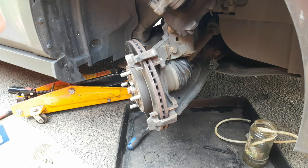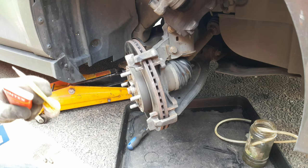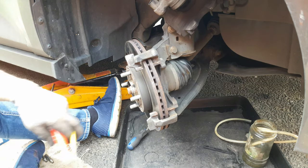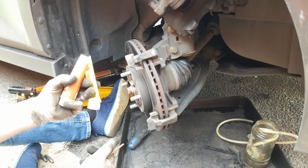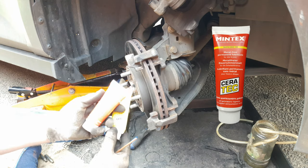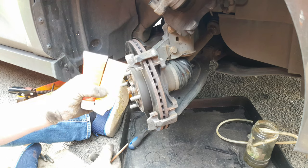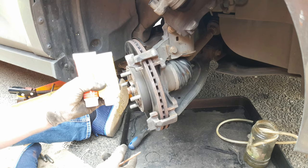Now it's time for a little lube just on the contact points and the slide pins. Do not — I repeat — do not use copper grease. Copper grease is not suitable for this application; it dries out and goes hard and in particular it causes the slide pins to stick, which leads to uneven wear on your brake pads. I'm using Ceratec. The new tube I've got is branded Mintex; I did used to have Textar. Whether you get it from Mintex, Textar or Pagid, it's all the same stuff because they're all different brands of the same group — TMD Friction.